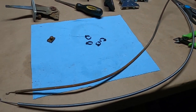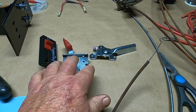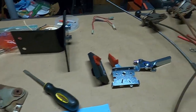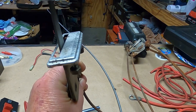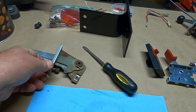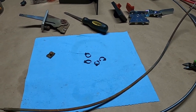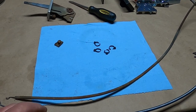I thought I'd take a look starting with the throttle cable first. I bought a universal one — actually I bought two of these because I need to replace the one on Red also. I've already pulled the knob off of this and I want to look at these other two to see if they're in better shape. I can see that one's bent there. This one looks cleaner, so we'll probably go with this one. But I'm a little leery on cutting this cable because we've found so many different design issues. I'm thinking I should really wait until I've got the engine in place just to verify the length.